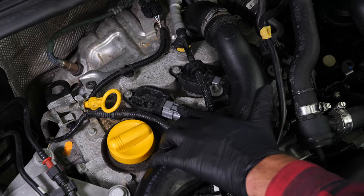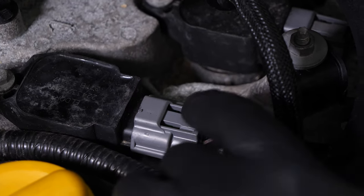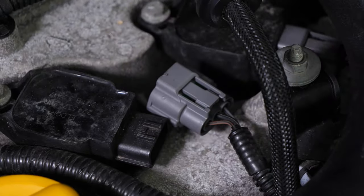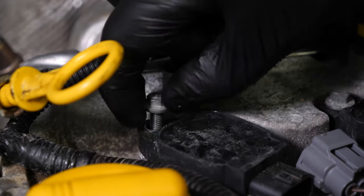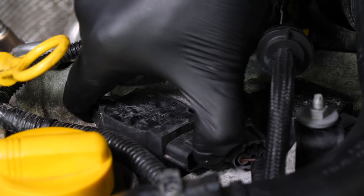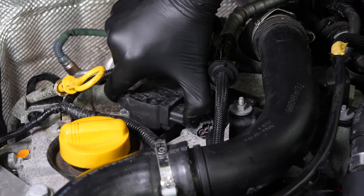Pull on the tab for the power connector to the coils, lifting it with a flathead screwdriver. Now remove the tab. Using a socket wrench and an 8mm socket, unscrew the lock nut located on the coil. You can now carefully remove the coil, making small lateral back and forward movements. Be careful — the coils are fragile.